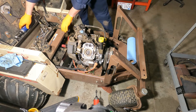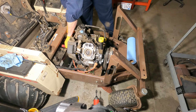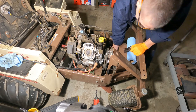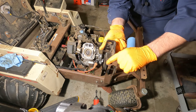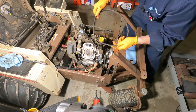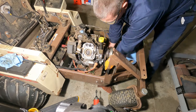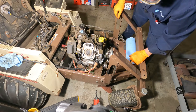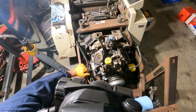That goes into that notch. We've got some wear there, some wear there, so maybe what I'll do is weld that up and then grind that to give it a little bit more life. We can talk to him, see if he wants to get some new belts. That idler is nice, good shape. So we've got the belts disconnected. This definitely is not like a Chevy Equinox motor.